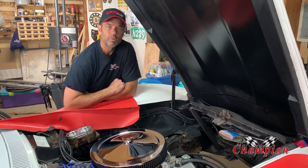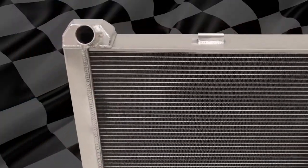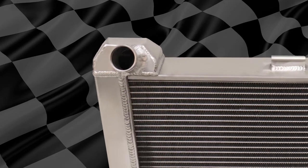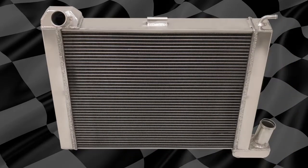We're going to walk through the installation and see how things go. This is the new radiator — I had cracked the inlet going into the old radiator. I don't think that's going to be a problem with this one; the welds on these things are really, really solid. The inlet and outlet aren't pinched — they don't have any flow restrictions like the original radiator. And look at those welds, it's just like that everywhere — beautiful.